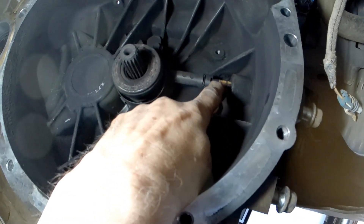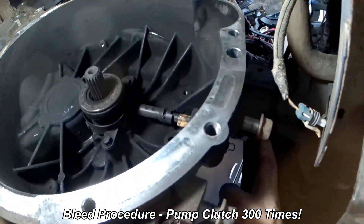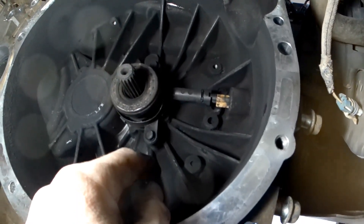I'm going to fill it with brake fluid first and hook it on. Then you put some brake fluid on this end, and when I hook it up it should be preloaded, so it should be easier to bleed.